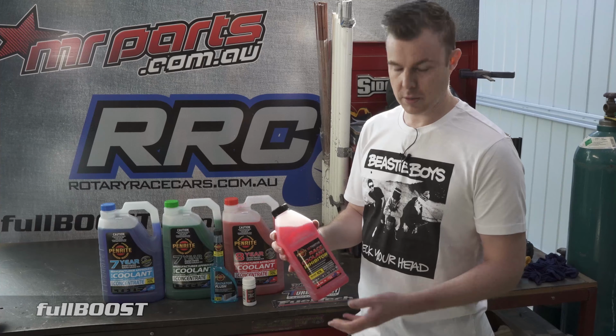Okay, so we've done our test and the results are in. Let's have a bit of a look here. So the first test, it says compare the end pad, which is this one up here, to the freeze and boiling point. And if it's between 33 and 50, no further actions required. Now, this is for red and this is for all others, which the other one's green. To me, it looks like it's right up here in this light scale, which means it's in the fail area because it needs to be down one of these three shades, and it definitely isn't. So we'll move on to the next one.